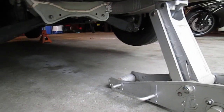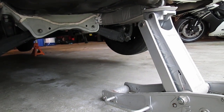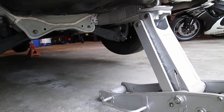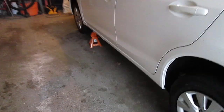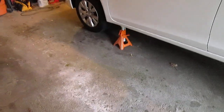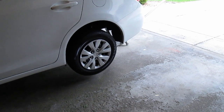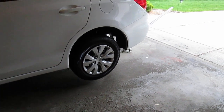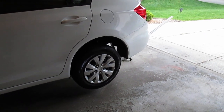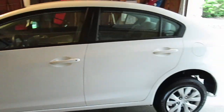We've got the car nice and high. We're going to do the same thing we did in the front — put the jack stands under the rear pinch welds and then lower the vehicle. To get it back down, jack up the front first, remove the jack stands, lower the front, raise the rear with the jack, remove those jack stands, bring the car back down, and release the handbrake. Thanks for watching — I'll have some other videos on different maintenance techniques for this car and others.